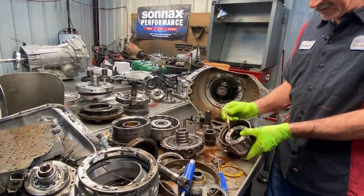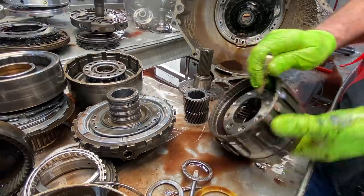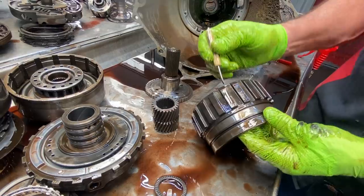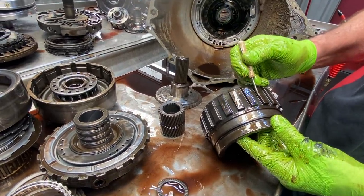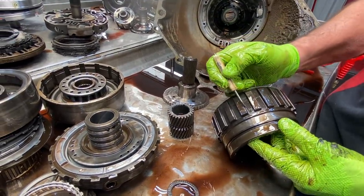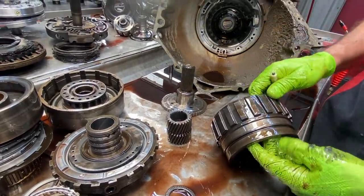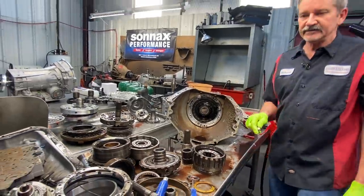On your rear planet, check for any type of gear wobbling, your brass washers missing, anything like that. Excessive clearance, pin discoloration. You also want to check it here and see if they've been ratcheting it in park — somebody doesn't come to a stop all the time, you'll get wear right here from putting it in park constantly. So you can see there's a lot of parts in these 4L80Es and it takes a lot to do them, especially to do them right.